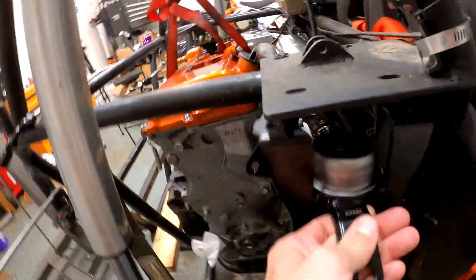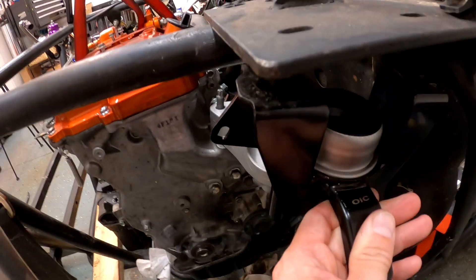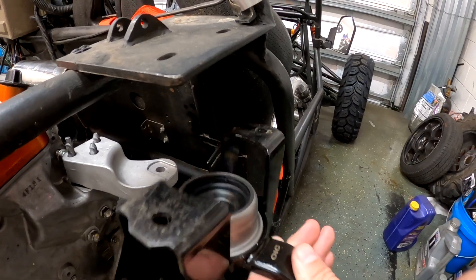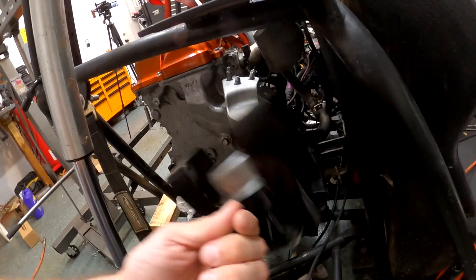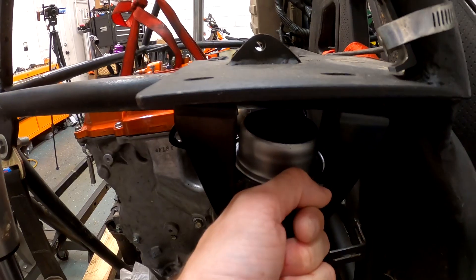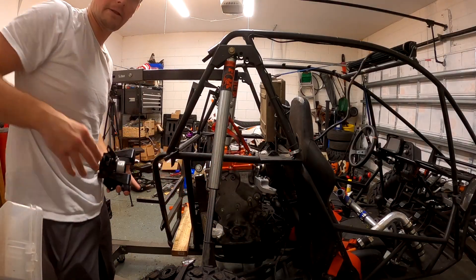This mount drops on there. My thought was to come in here, flip it upside down because you can see it's almost the perfect height, and then weld these brackets onto that frame rail. My concern is the back-and-forth movement would fatigue that metal. But I was talking to a master frame builder and he suggested I do the weld and then gusset the crap out of it. Let me get this thing chopped up.